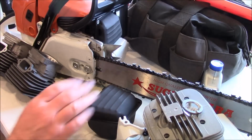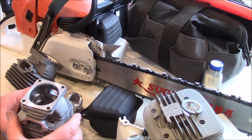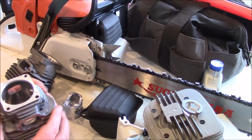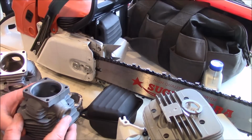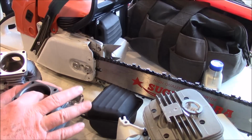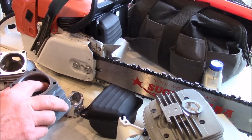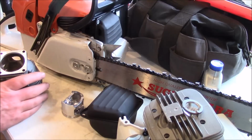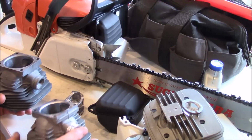And on the intake side, if you look at these cylinders as sent, they actually have quite large transfers on the 54 millimeter. And interestingly enough, the big bores will make more power, so that's an easy update right there for $50. But they also have even larger transfer tracks or tunnels on the inside, even though where they have them entering into the cylinder is not quite as large. I don't know if you can see that. Flip it around so they're symmetric.